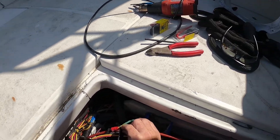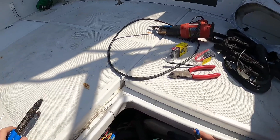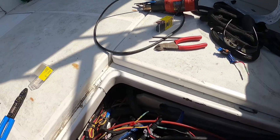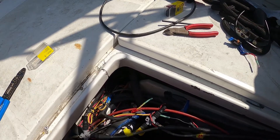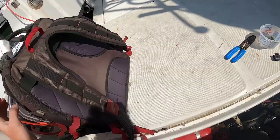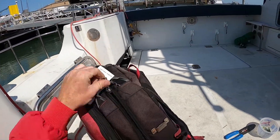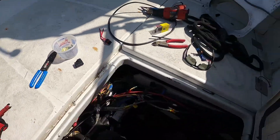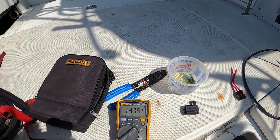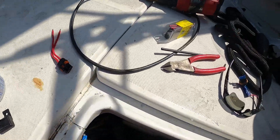Red on this side. And get some new, much better contact clips. So we're gonna do some testing and make sure we've got a good clean 12 volts going to our shifter. I'm getting 13.7, so we've got good power there.